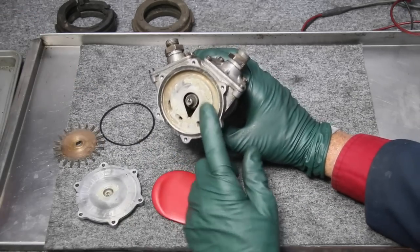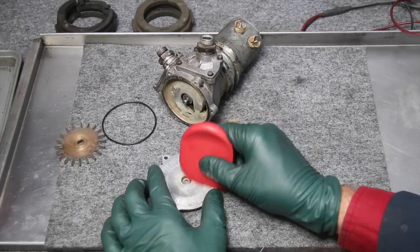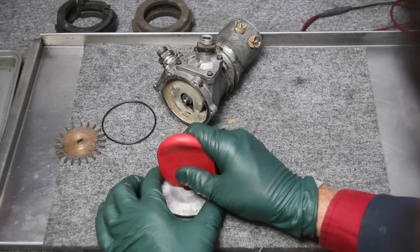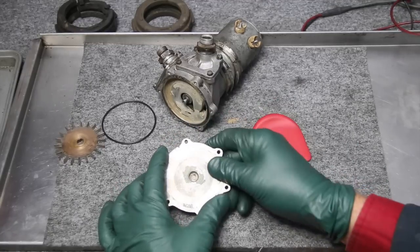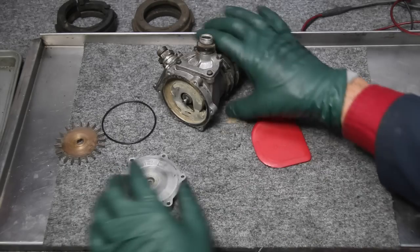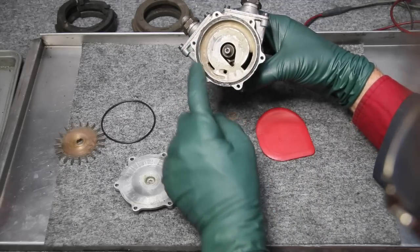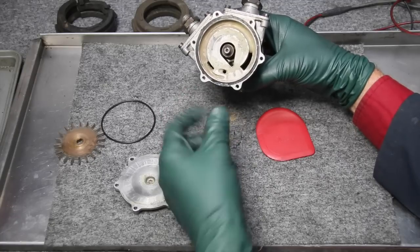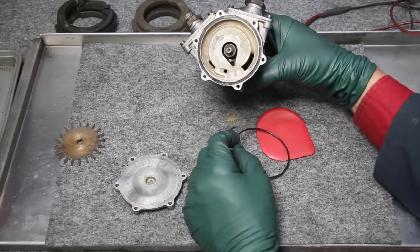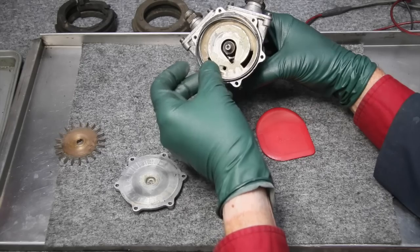I'm going to warn you right now — don't use sandpaper, don't use a scraper. I'm going to attempt to use a plastic scraper to see if I can scrape this off, and I'll get this in the solvent tank and try to scrape whatever this is — some sort of chemical residue from years of fuel. We're going to clean this off on this bottom plate. Then of course I'm going to have to get a new seal. Look at this one — somebody in the past has tried to use a little RTV silicone to reseal this. I have a kit with new seals for the short pump, and it just so happens that the same seal will fit the bottom of this long pump.